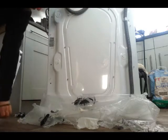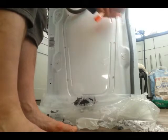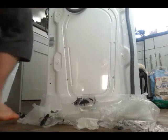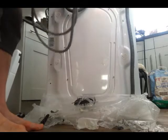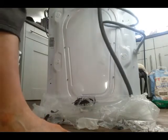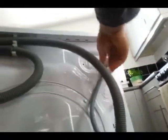Ready? Have a drain hose. Let's remove the plug. These are free. So, the supply hose. Make sure that the seals are there and are intact. The flat end goes on this side. Always make sure when you tighten it up, every few turns, when you tighten it up, make sure it's centered.